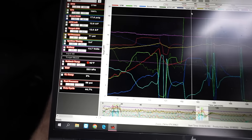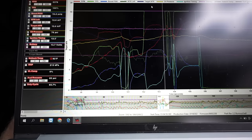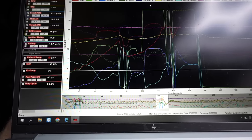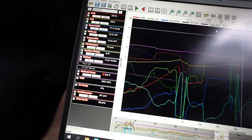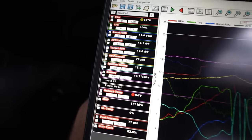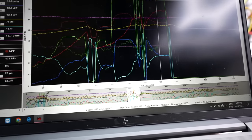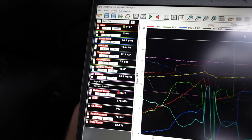Second pull shows 100% throttle, 18 psi boost all the way through. After shifting and riding out the gear up to RPM, boost dropped to around 10 pounds when it should stay at 18 — belt slip again. Belt might be too lax and may need to be tightened. Everything else looks decent — fuel pressure and oil pressure steady. Feels ready to send it this weekend.